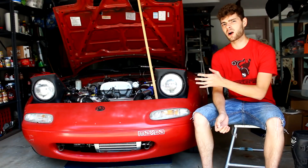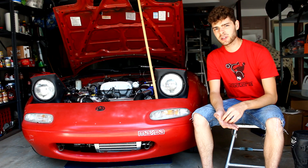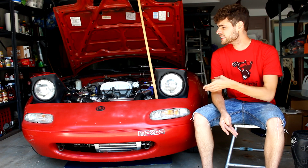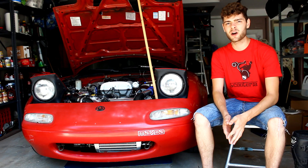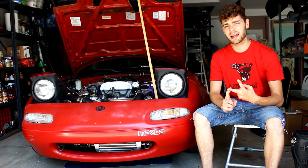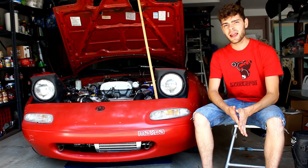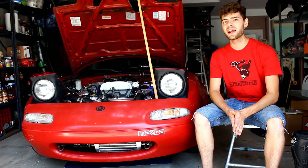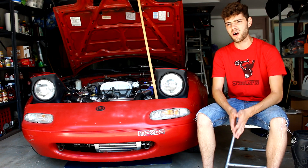Once I repeated this process a couple of times, my car was running pretty great — it felt really good and way better than it did just after starting with the base tune. This is definitely a decent way for anyone to jump in and tune a standalone ECU and keep it pretty safe. Run your car a little bit rich, do not advance your ignition timing from a base tune, run conservative timing, and pick a good high-octane fuel. You really shouldn't run into too many problems turboing a car yourself and setting up the tune — and this process works for naturally aspirated builds too.